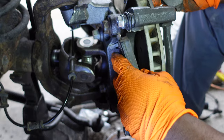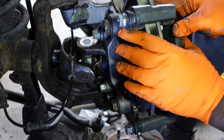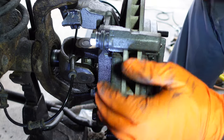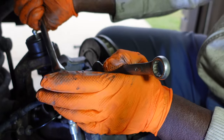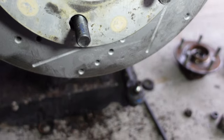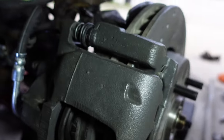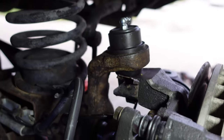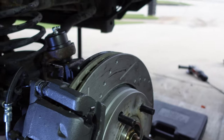Take our wrench and socket and tighten up the brake caliper. All right guys, from here you have everything on - got your axle nut back on, got the caliper, got the brakes in, got everything tight, got both ball joints in, got the bracket. Just slap your tires back on and we're done. There you have it - ball joints are done. Thanks for watching this video, be sure to like and subscribe to the channel!